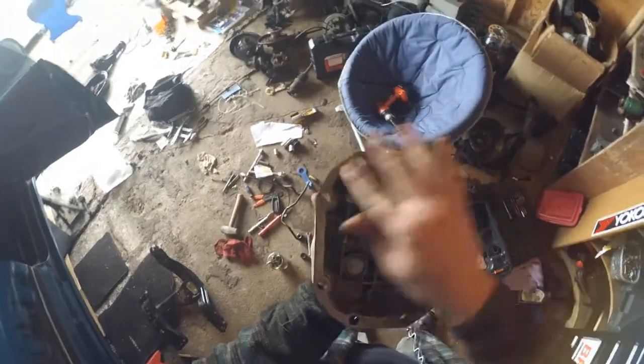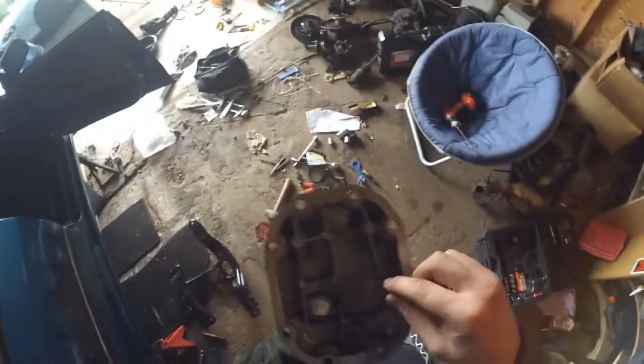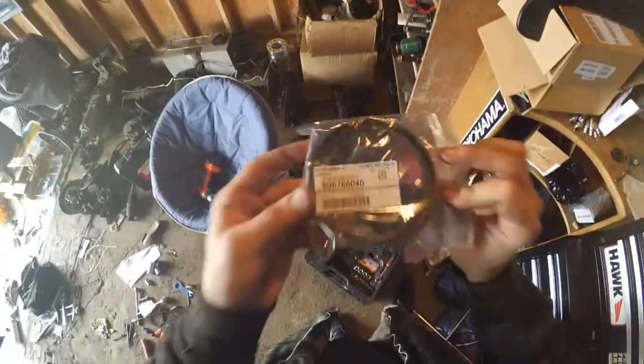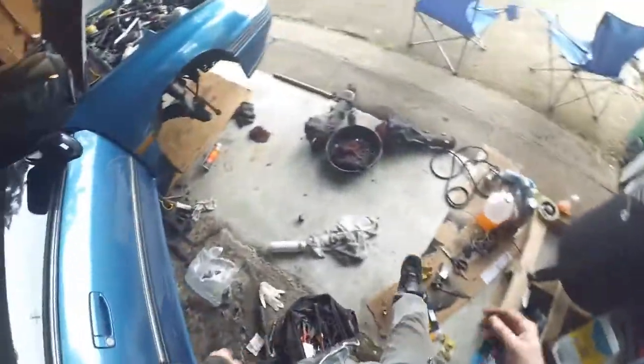I got a new little vent cap to go in here, and I still need to get the actual gasket to go around this edge, so I'm still waiting on a few more things. I also need the oil separator plate, but I got my rear main seal, so I'm going to work on getting that old seal out — I've already cleaned it up a bit. If anybody wants to see the part number from Subaru, you should always use OEM stuff because you don't want to have to take the transmission out twice.